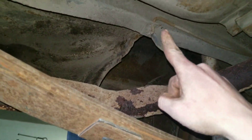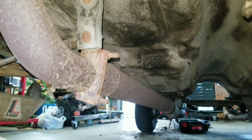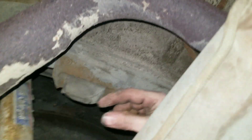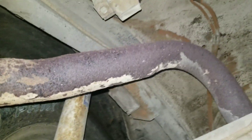With the fuel tank removed, what I'm going to do is work on removing the factory fuel lines. I got that line there, two lines right there, and they all converge down to the frame rail and head up the car. So I'm gonna work on removing those. Looks like this one is held on with a bolt here on the bracket. I got another bolt right here. So I've got a couple of them I've got to get taken out and then I will get the old fuel lines out.